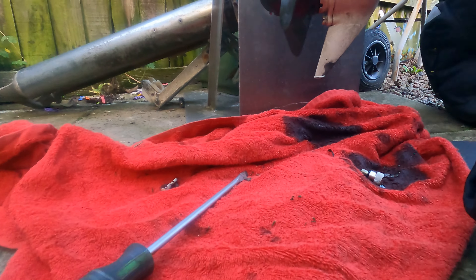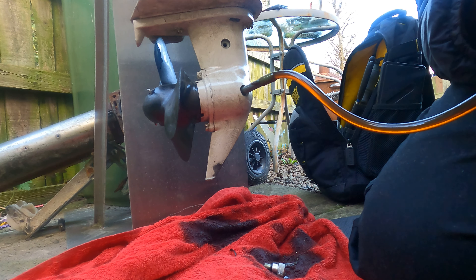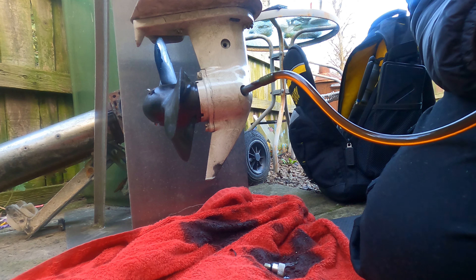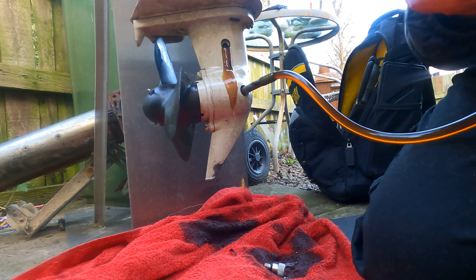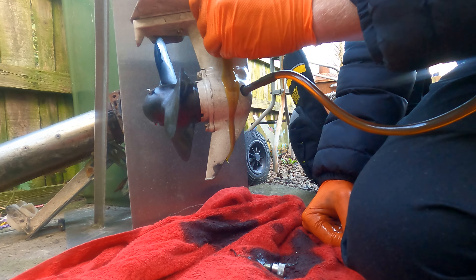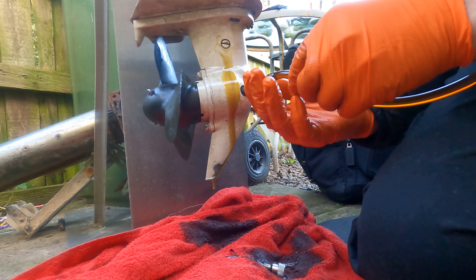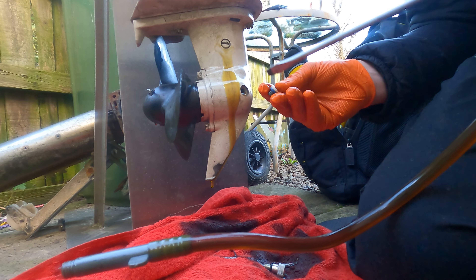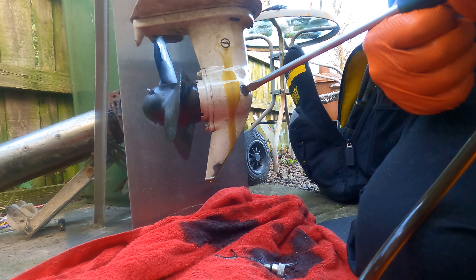It's not a big gearbox, but because we've had it open you know there's nothing in there. The method for filling like I'm doing here, like I do for every outboard, is probably the only way of doing it correctly. You can hear it coming out. We get the small plug for the top — I did check it's got an O-ring on it, sometimes they get stuck. Stick that one in there, and for the bottom one you just quickly remove the pump. Because we've got the top one in, the oil is quite cold and viscous, it's not gonna come rushing out, and we can just screw the lower one back in.